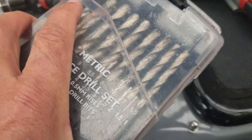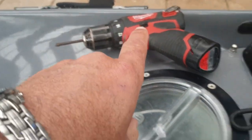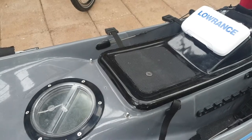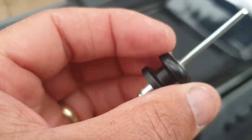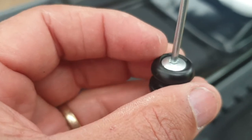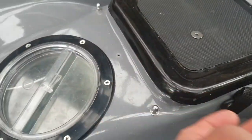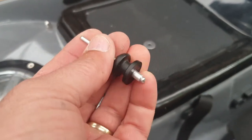You need an appropriate drill — I'm using metric — and a pop rivet gun. I've got a cordless one, which makes things a little bit easier. Just make sure that when you place the pop rivet in, because it's such a large one, just rest it a little bit below the tip of the button. This will ensure you've got plenty of shank depth for the washer and the fiberglass — or carbon fiber if you're a yuppie and can afford one, but for us common folk we just go with fiberglass.